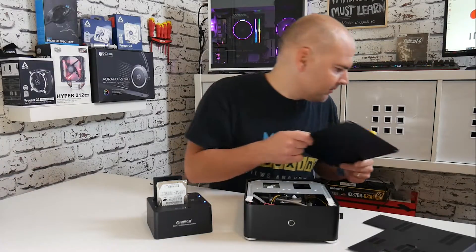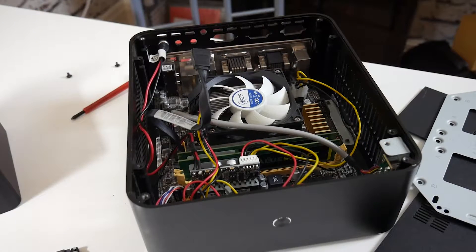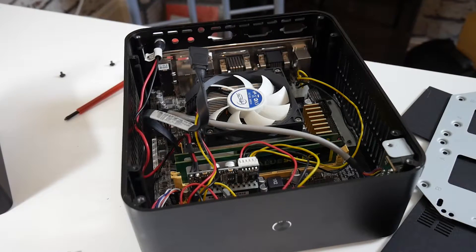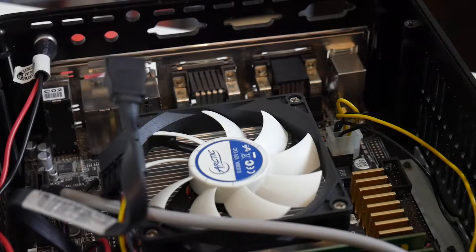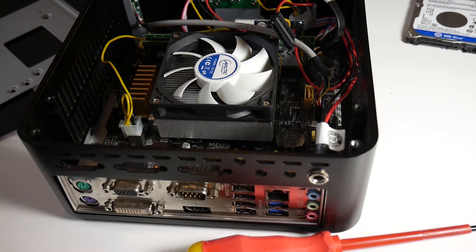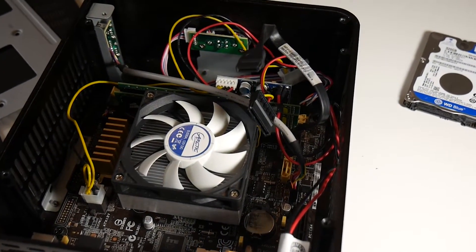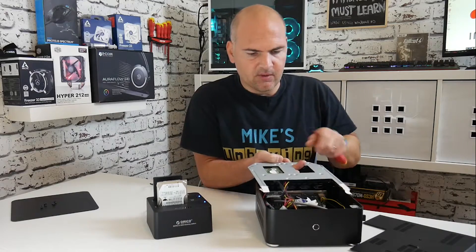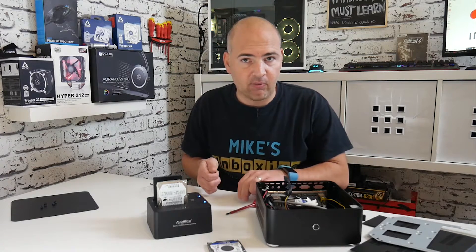The one thing is it's so well made it's very difficult to get the top panel off. Inside the form factor is very tiny — I've actually stuck the drive in with a bit of tape because I lost the screws. It's very empty in there, but we do have an Arctic cooling fan which keeps things nice and cool and quiet. Hopefully with the new SSD in there it's going to be completely silent, because although the machine doesn't have any really noisy parts, the mechanical hard drive was actually the loudest part. It looks like we've got a little while left on the drive cloning tool, so I'm going to go listen to some music and I'll be back after it's finished.